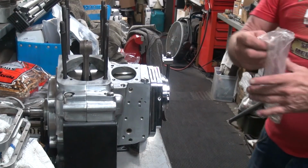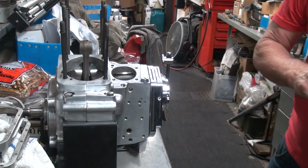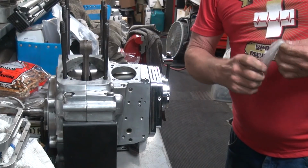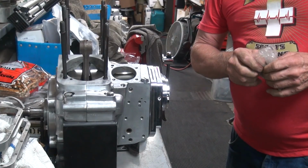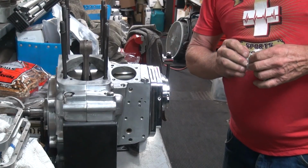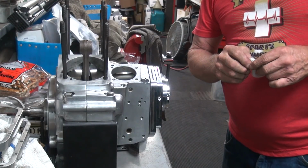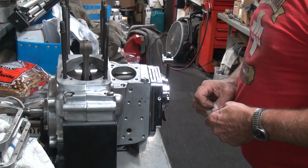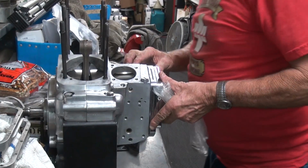Oh, okay. Now, see, I would never, no, you would never do that. I would never tie it, no. Okay, so what's the holdup now? Where's your lifters? The lifters are over here. We gotta try them. Why did you take the cover off? You didn't check your breather yet. How's the breather in play? Oh, I didn't check that. Push it on the cam cover, put your finger in a hole, and just see what it is.